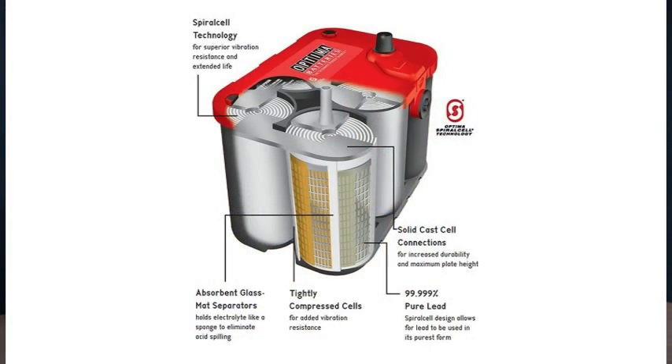Now, the battery types I mentioned — flooded, AGMs (absorbed glass mat), sometimes called sealed valve regulated or recombinant batteries — they recombine. We cannot open the sealed batteries to add distilled water, so their charging regime is very specific.